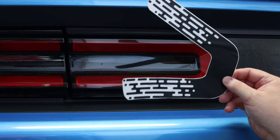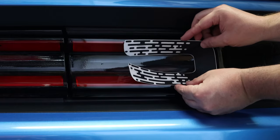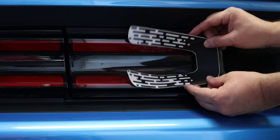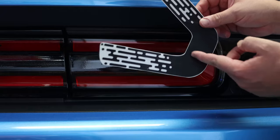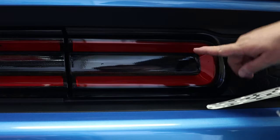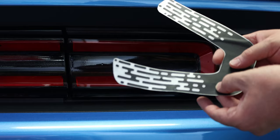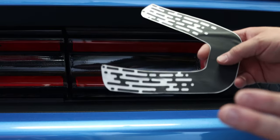Now it is ready to go ahead and put that fade on. Cut out the taillight fade just like that — that is going to be your easiest bet. You want to get all this material removed because you want to be able to bend and manipulate it within the taillight itself, since it is very concaved. With that material out of the center, you can bend and manipulate it very well and very easy. You're going to kind of hold it up, see where you need it. I'm going to peel half the backing off, do the bottom first so I can make sure it's straight and lined up. This vinyl has little diamond shapes in it, which helps remove air bubbles — super cool and makes it very user-friendly.